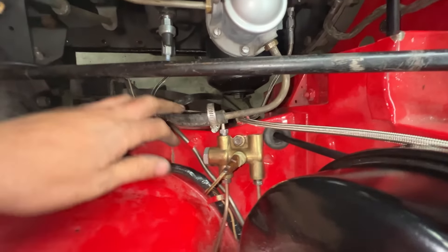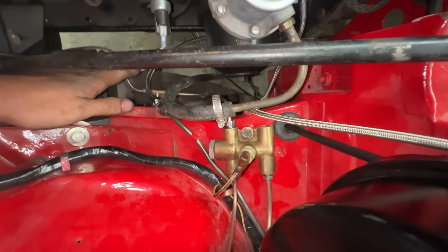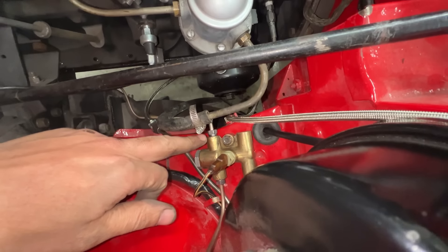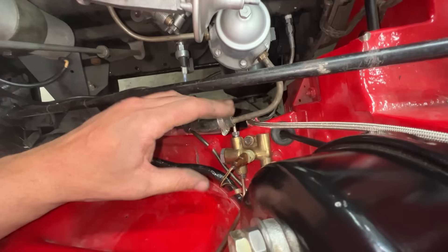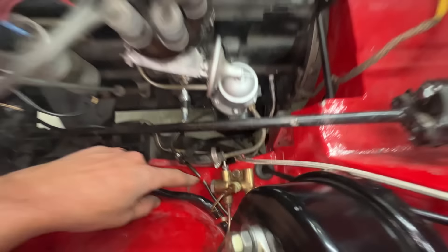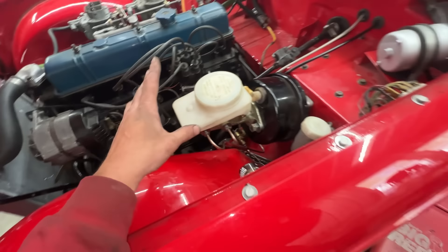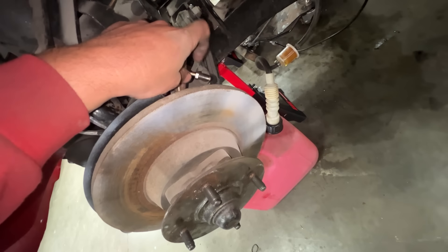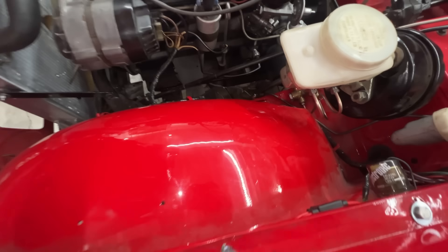This line is made and installed. From the three-way splitter down there it comes up to the front port of the PDWA with the big fitting. One last reminder: the three bigger fittings are at the master cylinder ports and PDWA connections; everything else is the same 3/8 by 24 threads, except on later cars the two caliper fittings are metric. That completes the front brakes.